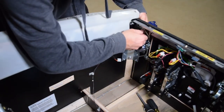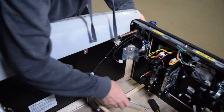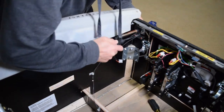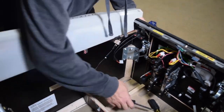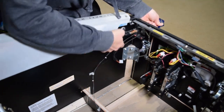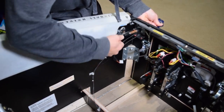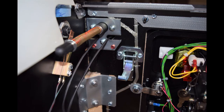After installing the base plate, install the three phillips screws that hold on the housing. Make sure to use the proper size screwdriver so as not to strip the three phillips screws. You can pull on the shooter rod to gain access to the upper left corner screw. I would recommend installing the center screw and right side screw prior to installing the left side cabinet wall screw. Here is how it should look with the lighted shooter rod installed along with the new base plate.